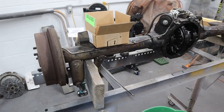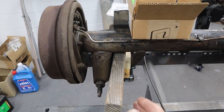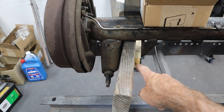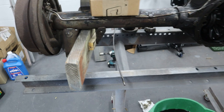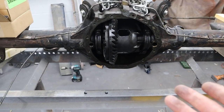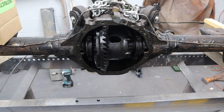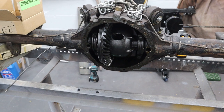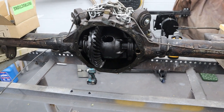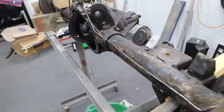I went ahead and put it up on my little rolling rack. I've got a 2x6 across the way where the trailing arm goes, and I put a piece of 1x jammed in there with a hammer on each end — it's pretty stable. I pulled the cover off and let it drain. I didn't see any shavings or glitter in the oil. The gear oil seemed a little thin, way thinner than 90 weight, and it didn't even smell like gear oil. I'm not entirely sure what fluid they had in it.